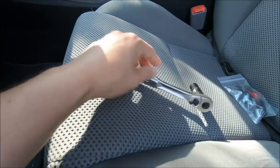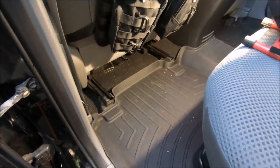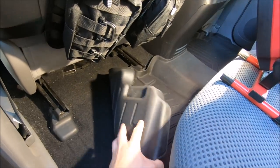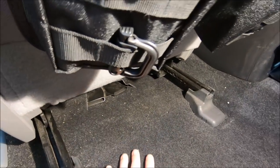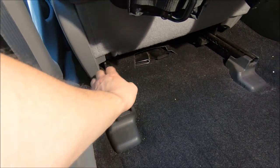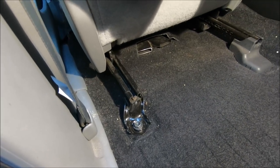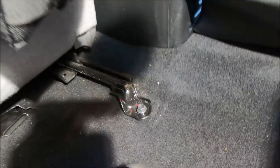Okay, I think that should be good enough. Now I'm just going to slide the whole seat forward. Now in the back with the seat slid all the way forward so I have as much room to work as possible. I need to get my WeatherTech one-piece floor mat out of the way real quick. Obviously, I need to do a little vacuuming. So the next step — you have these two rubber covers for the bolts holding the back of the seat. Just pop them off with your fingers. If they're on there really tight, you could use a small plastic pry bar, but they pop right off.